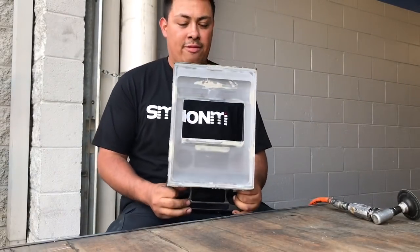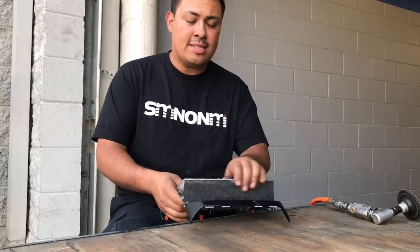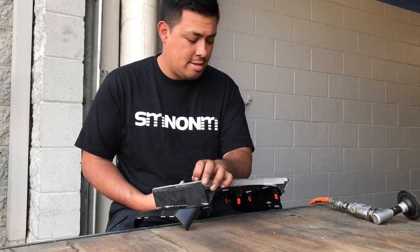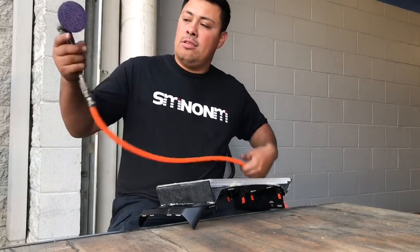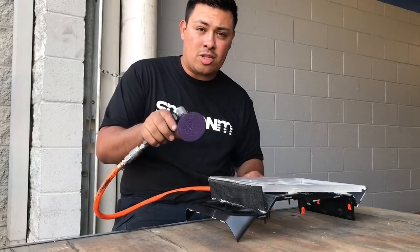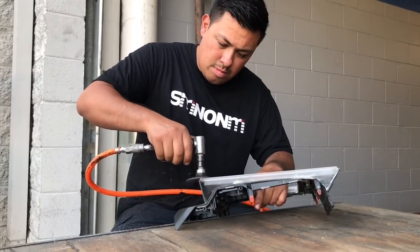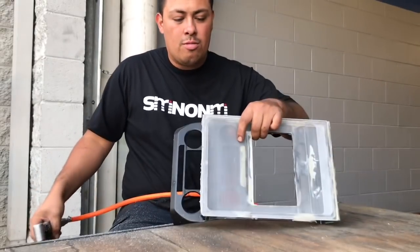We got our big dash for the F-150. We're gonna sand it, scuff all the epoxy, and then hit it with what's that stuff called, Doug? Sandpaper. No, the fiberglass thing. Bondo glass. I'll show you guys what that is. So on my grinder right here, we put 36 grit, and we're gonna hit the whole thing. Ooh, it's gonna look nice.